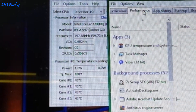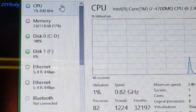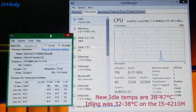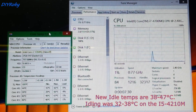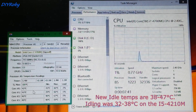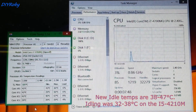I'm opening up Task Manager now just to see the CPU speed, and it's performing well, idling at around 0.7 gigahertz — a very good and efficient power-saving mode when the computer is doing nothing. I found out that the computer now uses almost the same energy, around 18 watts instead of 12 to 14 watts at idle. So for double the cores, not really much more power consumption at the wall.